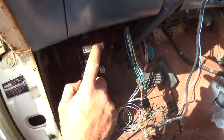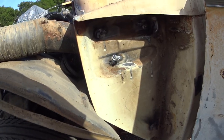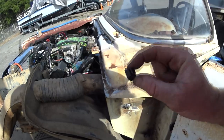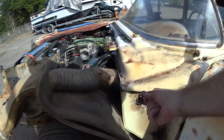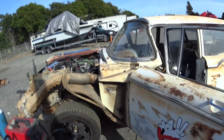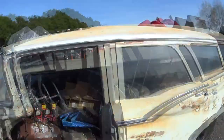Well, I think that about wraps it up. You can see the emergency brake and parking brake works, the brake release works, and like I said, if we ever need to replace this mechanism again these bolts will just unscrew right from here. I'm really not impressed with those welds, but they will work, and once that fender is on here you will never see my shoddy work ever again. We did resolve the issue of these stupid little square cage nuts - crappy design, not meant to last 60 years. I'm sure they figured this car would be crushed within 10 or 15 and weren't worried about making things easy to fix 60 years later. But we resolved it, and we're close to driving this thing - so thank you guys for hanging out with me while I replaced that bracket and resolved that issue. Until next time, be excellent to each other!